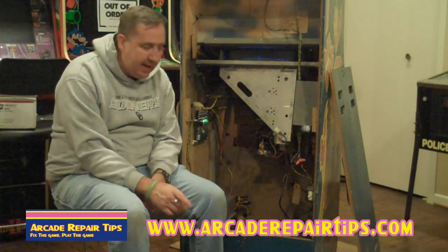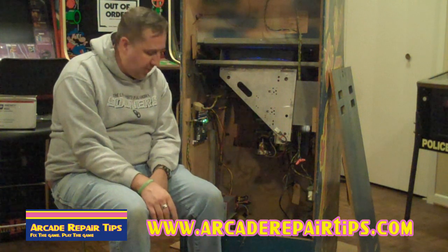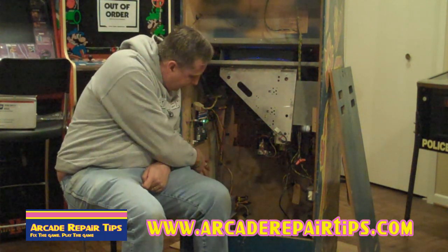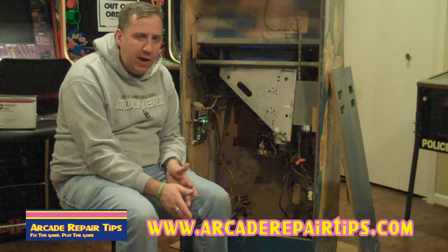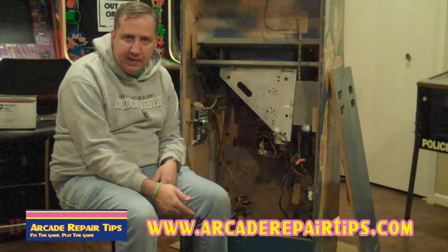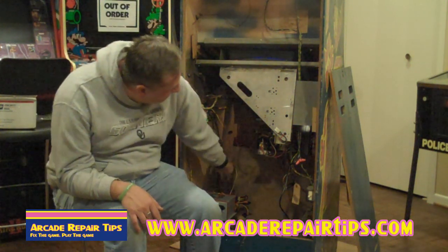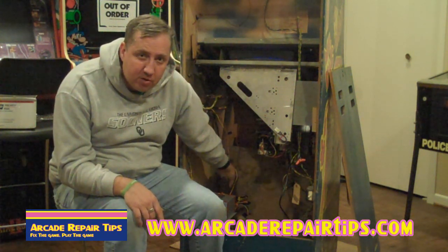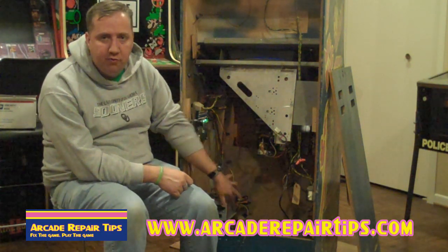Now, here's something that they didn't tell us and we didn't have instructions for. We did have to come up with a way. They sent the power supply, and on the video they had, they mounted it to the side. And we were trying to think of a way that you guys could do this without having to spend any extra money or anything. So you might remember, if you go back, there was a bracket back here that holds your Ms. Pac-Man daughter card. And we took that and we used it as a shelf. And then we set the power supply on here.